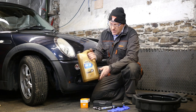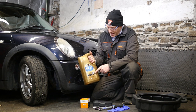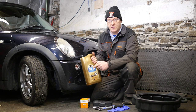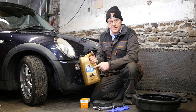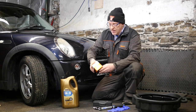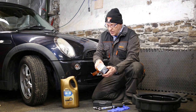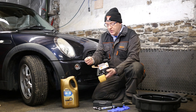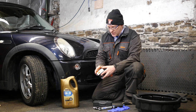I'll be using SAE 5W30 to C3 spec oil. The W stands for winter, meaning the viscosity of this oil in winter is 5, and under normal operating temperatures it would be 30. We need four and a half litres of that. I'll also be using a standard aftermarket filter, and you also get a new seal to go on the aluminium housing.